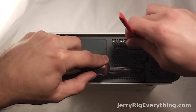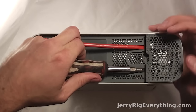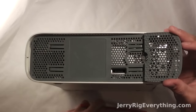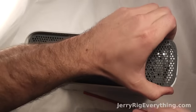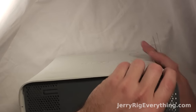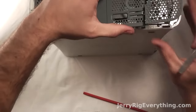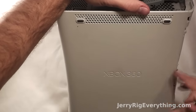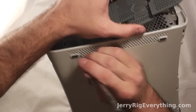The side face plates have two little notches that you're going to slip some tools inside of — it could be a screwdriver, it could be a pry tool — and it just lifts the edge of the face plate up so you can grab it. Once you have a little bit of it up, there are six clasps around the outside. What you're going to want to look for is the two white holes that are filled in, and press in between those two holes to release the clasp.